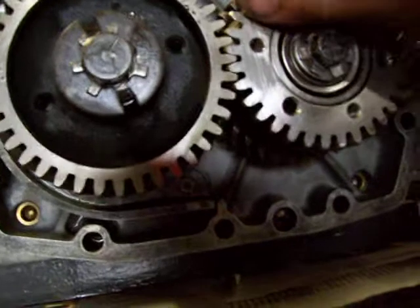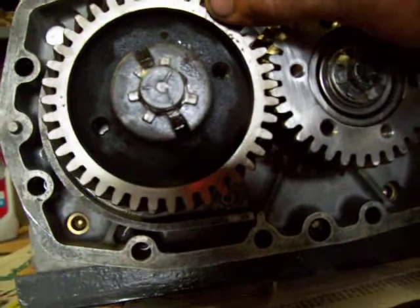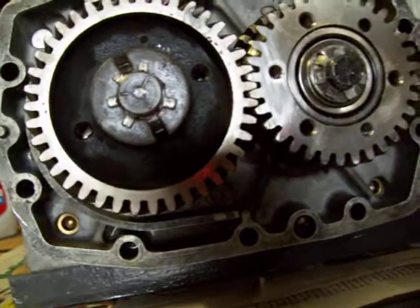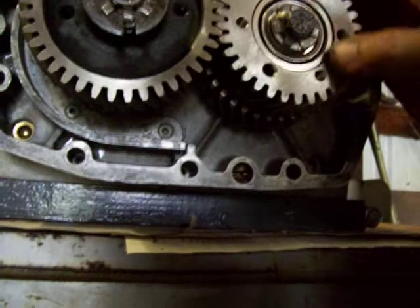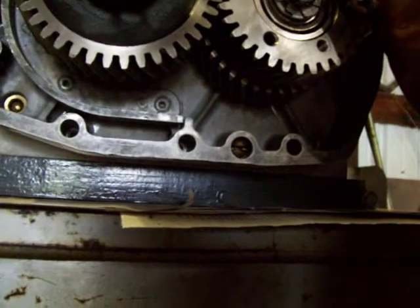I really think this is a big bore blower, and that's why they reduced it, because we've got two cranes with 671s in them, and one has this style blower and the other just has a single straight drive. But I think we're going to overdrive this one anyhow, and I'm guessing 25%. That's what I'm going to tell them at BDS, unless they tell me different.